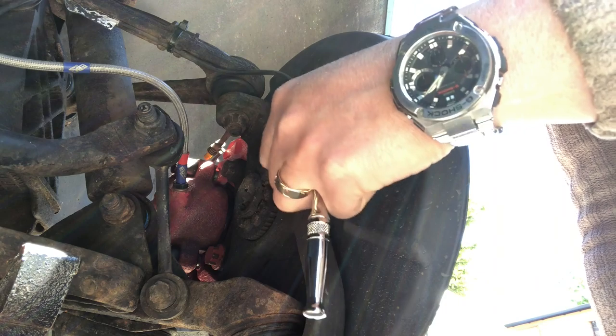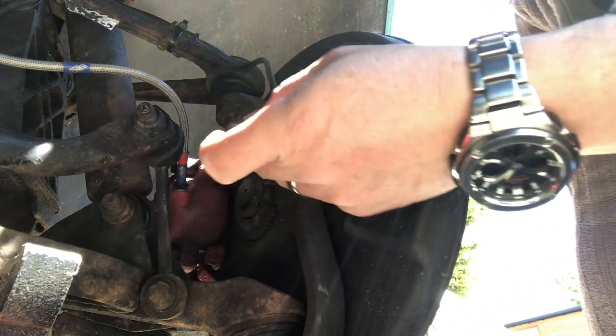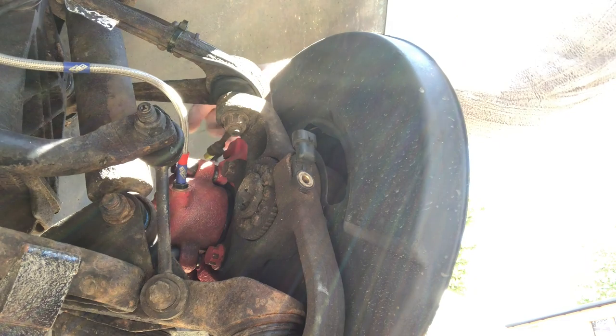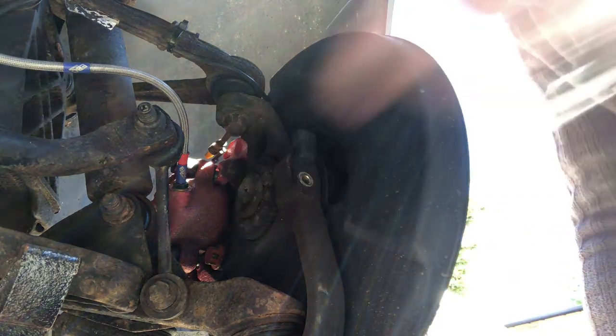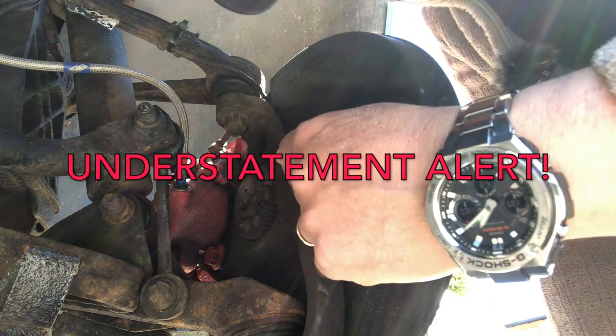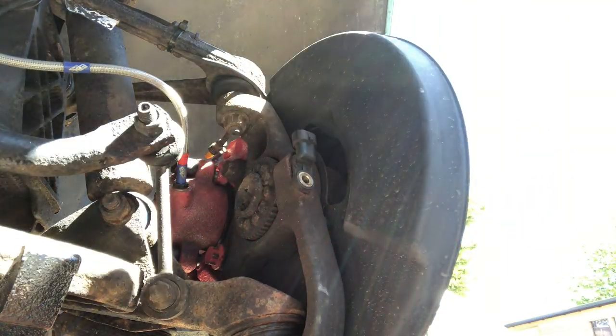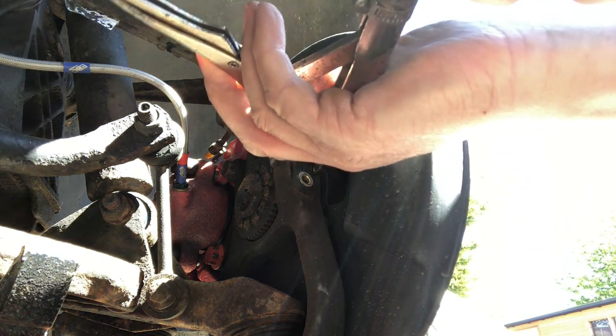Mine's a very early car and has this extra wire attached. It seems quite a few things were taken off probably after the first two years as a cost-down - various trim covers and niceties removed. That's just an earth wire to cut down on electromechanical noise and electrostatics. In theory it just pulls out, but mine's stuck and we may be in for a bit of a battle - it may end up with me drilling it out. I suspected this had a fault because I couldn't remove it just for inspection previously.